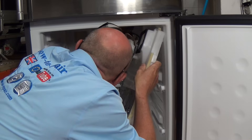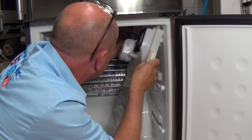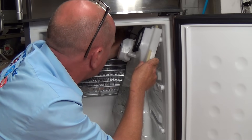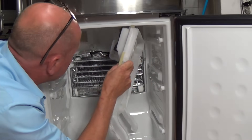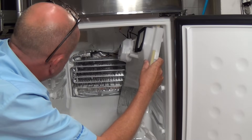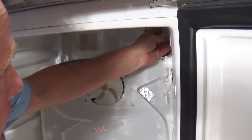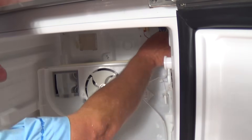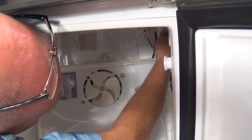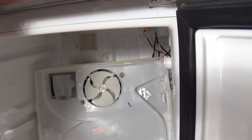The fan motor slides in. I apologise for the angle of filming and for sweating profusely on this video, but it is in excess of 35 degrees with these camera lights. Make sure your tape is good here because that's the airflow system. Once you've got the wires in, make sure you put your cover back on — it just slots over and clips in either side. This stops any moisture or ice building up onto the electrical side, because that is the high voltage side.